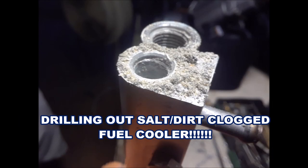I'm going to tap this and put in little aluminum plugs, and that is the conclusion. I hope you learned something in these last two videos — the flushing and the fuel cooler. The reason I went through all of this is simple: after five years of using the flush port on the Suzuki and not running it in a barrel, sitting in the Florida sun and heat, this thing stopped up with salt, debris, and mud. I have a picture of us drilling it out — you should see the stuff just pouring out. Heed the warning, Jacksonville people, Jacksonville fishermen and boaters. Thanks for watching.